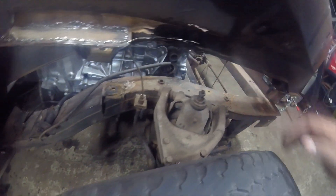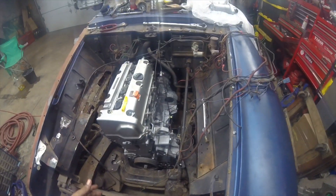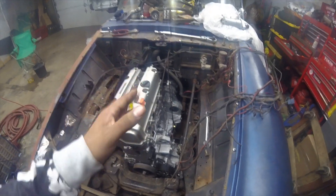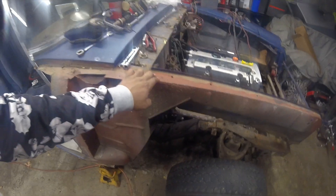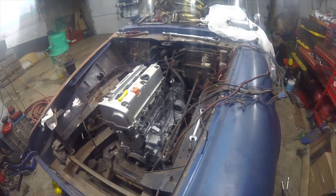As you can see right here I've welded this — it holds. I still need to seal it correctly and cut out the bottom section, but other than that it's pretty solid. The only rust this 56-year-old car has. Right now I'm going to work on leveling the transmission and installing some type of bushing. The Miata transmission originally has no transmission mount, so I'm going to try to reuse a motor mount or the stock Datsun transmission mount — whatever works.